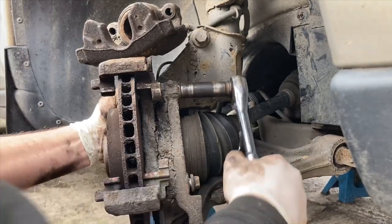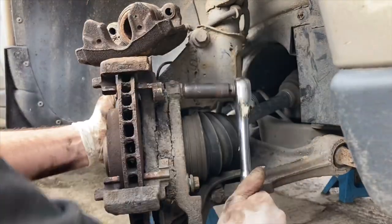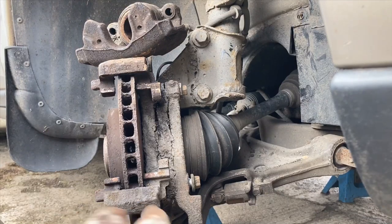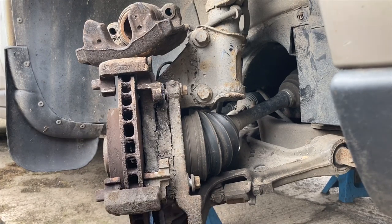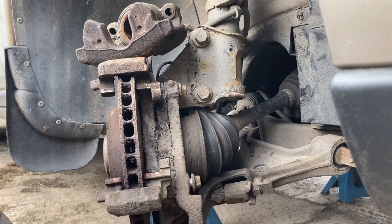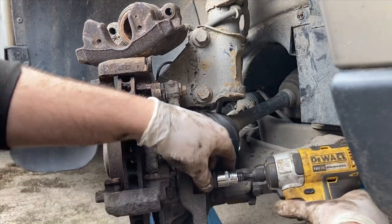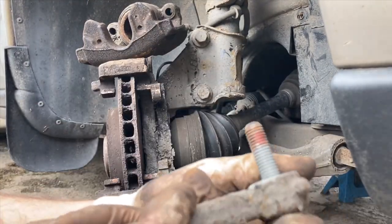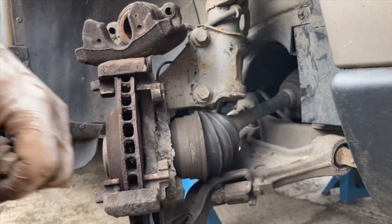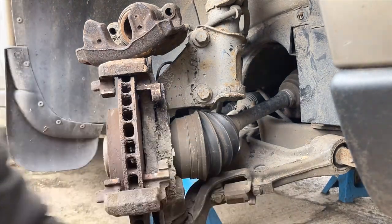There we go. Now before we move this all the way, just make a note of the orientation of this bar — there are two individual pieces here. There's the bracket that holds the brake pads, and then there's this little bump stop for the steering. It bolts onto the back so it will contact here when you reach full steering lock. That's why it's tough to remove — it's got the old brutal red Loctite on. I don't know if it comes out from factory; I'm not an expert on these D5s, so somebody out there leave a comment.